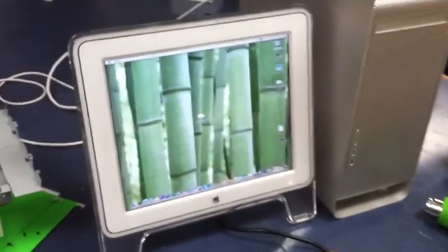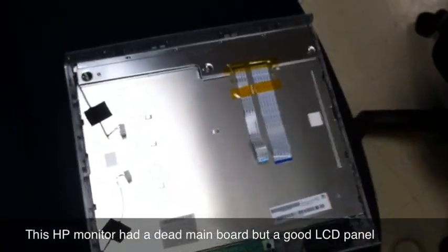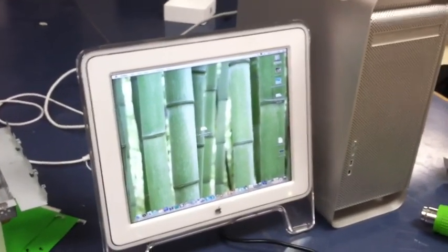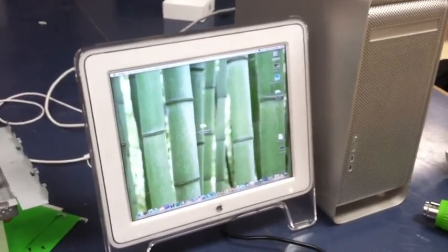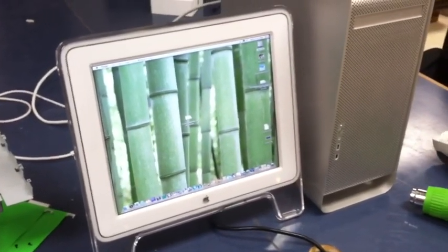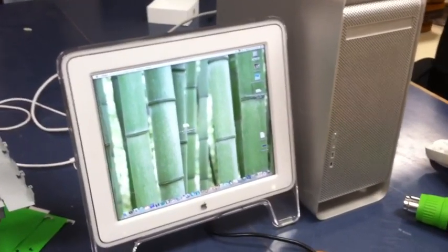I'll show you what the final product looks like — and there's our final product all put back together. I was going to try and borrow this LCD panel from an HP monitor, same size, similar specs, but unfortunately the connectors didn't line up. This Apple Cinema display had more of a unique board attached to the LCD panel itself, so it's not so much interchangeable. But I thought I'd show you what it took to get this monitor back up and functioning. Thanks for watching.